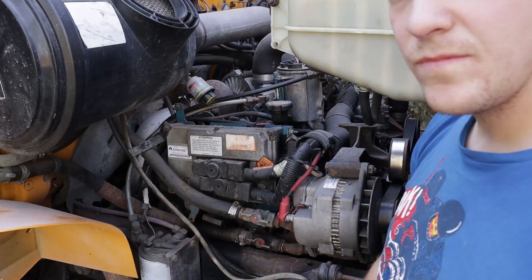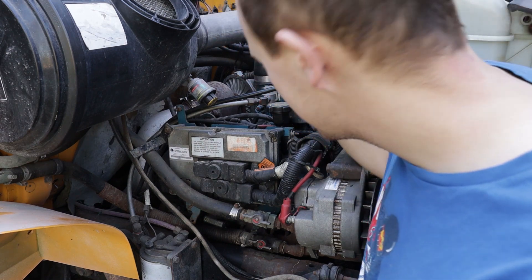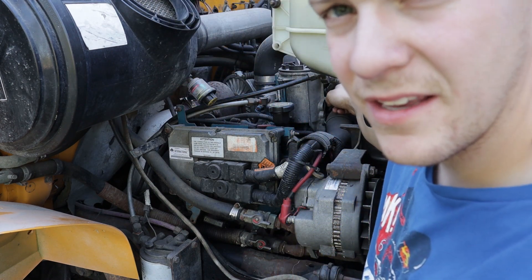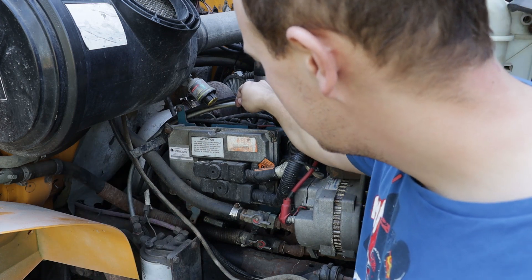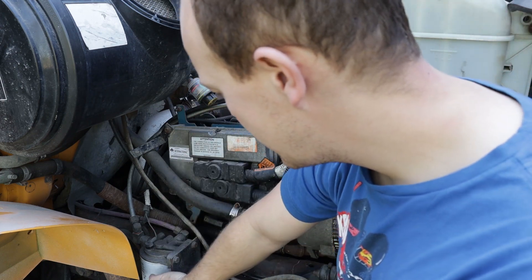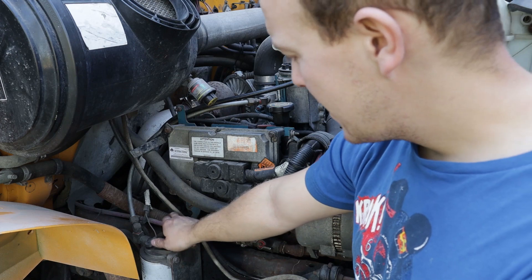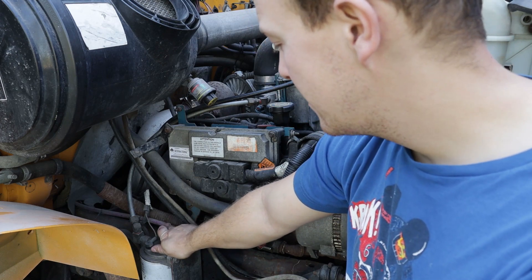Here we are in the front of the bus. I think this is the fuel bowl and the fuel pump is on the backside over here. This line is the return line that heads back to the tank. This silver line right here runs down to the inline fuel filter, which is on the side of the frame. On top of that is a red supply line — we are going to be tapping into this supply line with a half-inch connection.